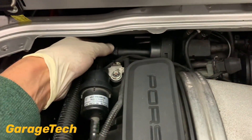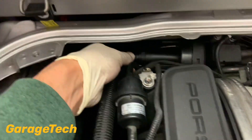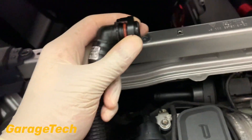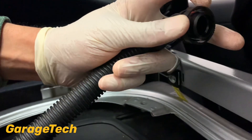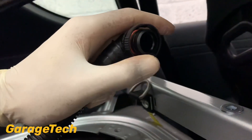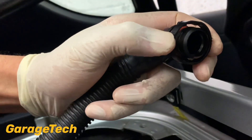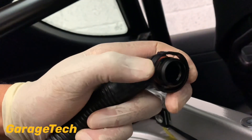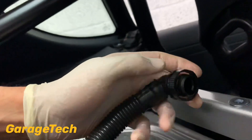These pipes come off — they are a little bit tricky. It's hard to do with just one hand, so I've loosened it already just to make it easier, but it just pops off. What you need to do is squeeze these two bits here. When you squeeze it, it just lifts up because you've got a catch there — a catch here and a catch at the bottom. If you're struggling to squeeze it, use a very small flat blade screwdriver. Be really careful because these can become quite brittle and they snap quite easily, and if you snap this off you'll need a new pipe.